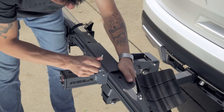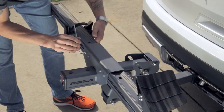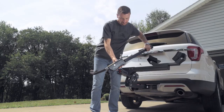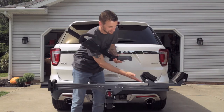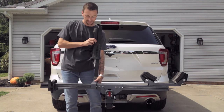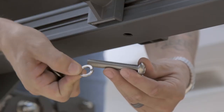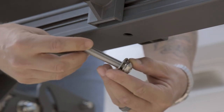With both front and rear wheel cradle tubes in place, use the supplied 4-millimeter Allen wrench to tighten all the center support tab screws on the single bike center support. The next step is to put the convoy's arm assembly together. Begin by sliding the arm assembly grip onto the rotating arm assembly. Make sure that the grip lever is on the same side as the detents on the arm. Because of the unique modular design of the Rolla Convoy, the arm assembly can be mounted in different places along either the front wheel tube or rear wheel tube, depending on whether you are securing your bike by the front wheel or the bike's frame. To secure your bike by its wheel, fasten the arm assembly to the front wheel tube using the supplied button head screw, lock washer, and flat washer.